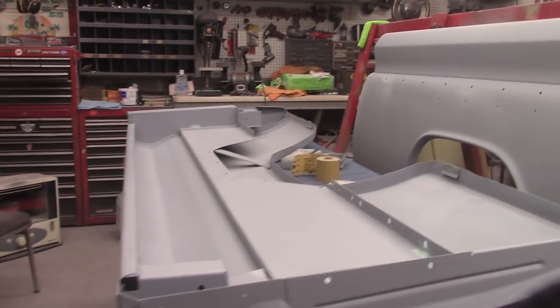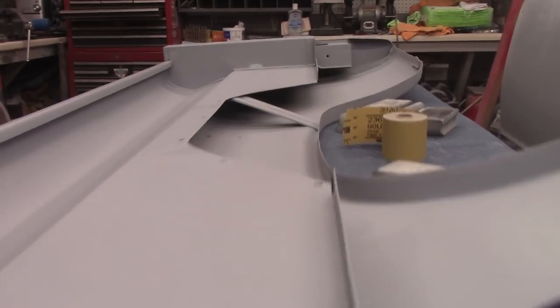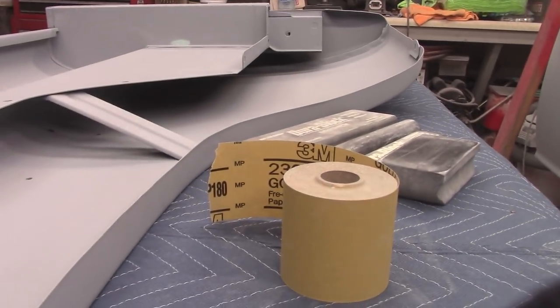There's some pits going on right in there. Went on and cut a scraper down right here and worked that in, so that's going to work out. I've got some overspray back in here, but that's okay. I got to get all that scuffed up real good before I do the bed liner. Yeah, I'm going to get started with that 180.